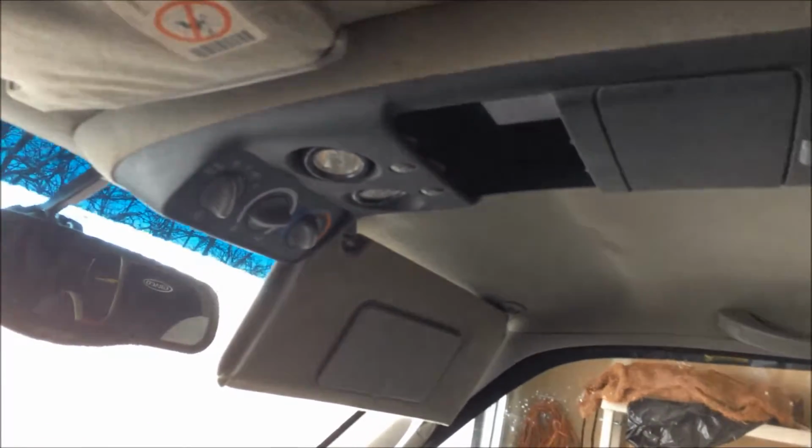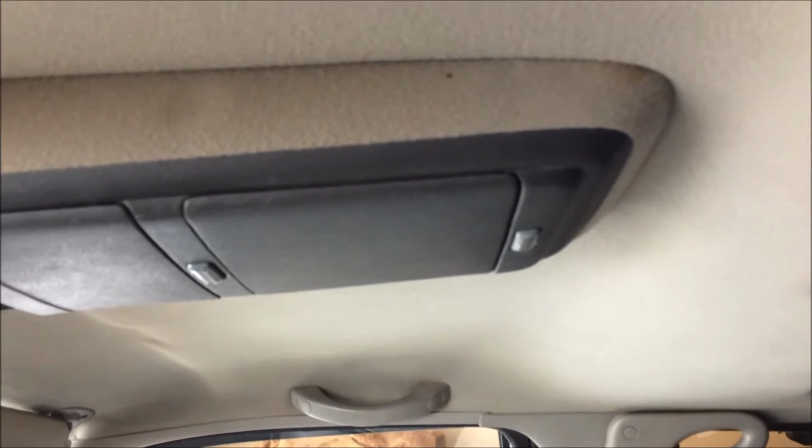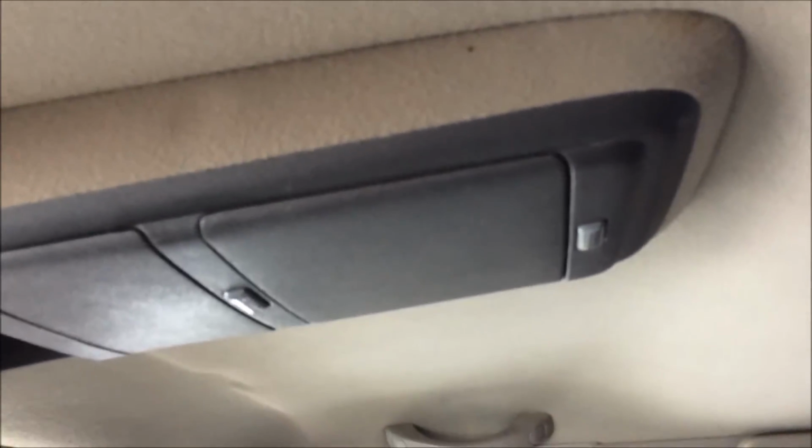It's in. All you got to do is go to a junkyard, find yourself that. If you got an SUV like mine, then you know you've got the slots in there to be able to mount this one. You can mount either the short one or the long one, whichever you choose to. And I would suggest back here doing small exploratory holes first, and then figuring out where the two notches are at. And be careful of that wiring tray that's under there. I nicked it a little bit but didn't touch any of the wiring. So obviously my stuff back here is still working.